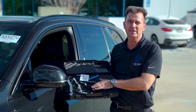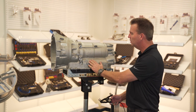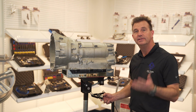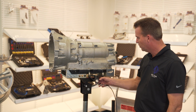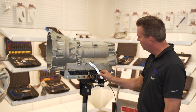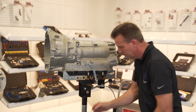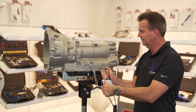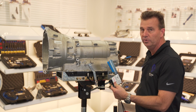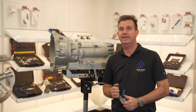Before we use the park release tool right here, let me show you in detail how it works. If they were all 2-wheel drive units like this, life would be easy. Grab the tool, put it on the studs, grab the lever, put it in the hole, engage the tube, squeeze the lever, and you're done. But life is not quite that easy.